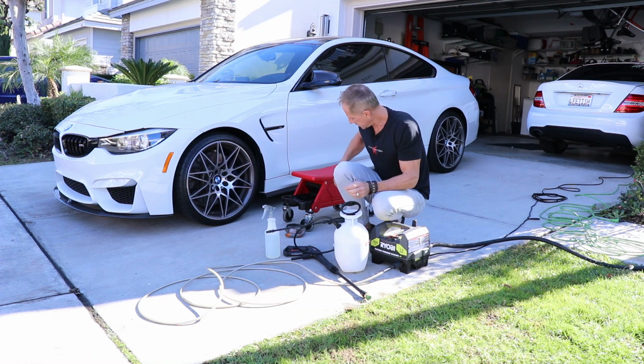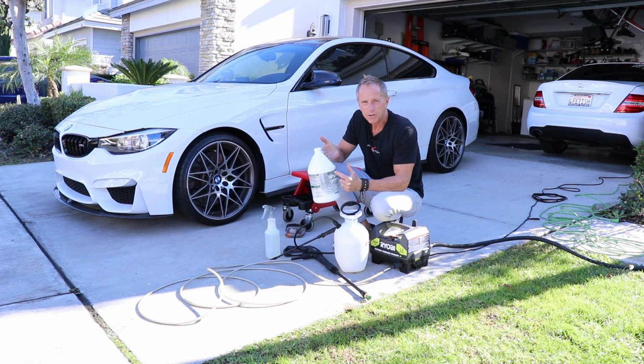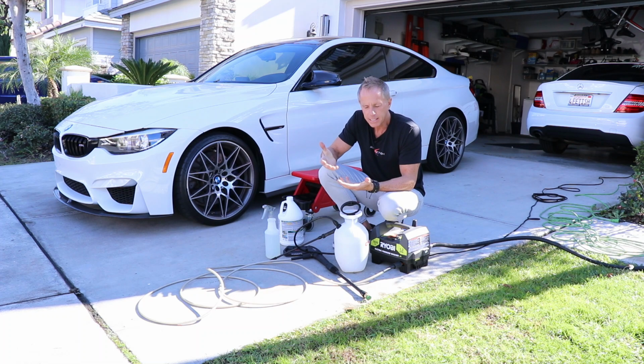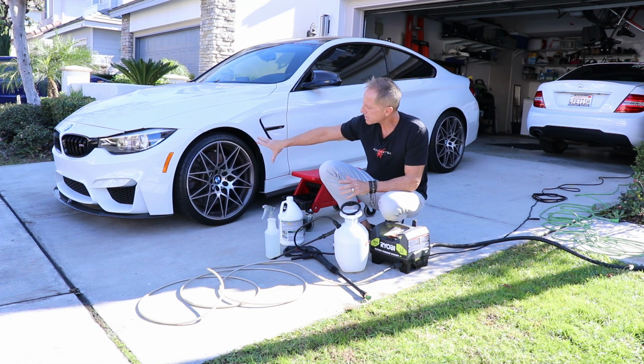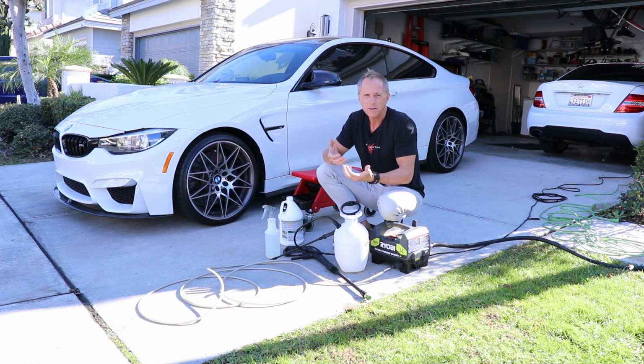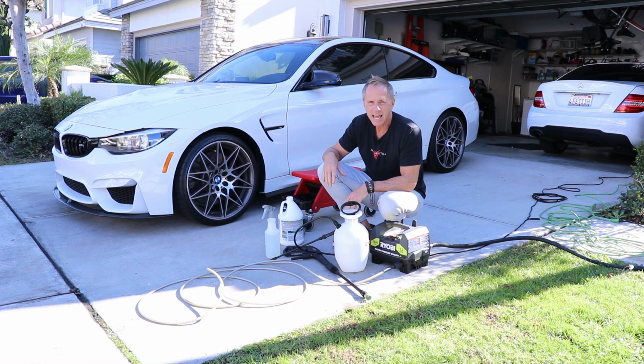Now, what I do default to is Simple Green. It's an all-purpose cleaner. I can use it for many, many reasons. It's very, very economical, way more economical than any dedicated car wheel cleaner. I consider wheels heavy-duty cleaning. It recommends a 15:1 dilution ratio. I'm going to simultaneously clean my wheels as well as the sidewall of my tire. When I clean my tire, I want to degrease it because it will naturally build up some greasy grime along the way. With all that said, let's get into action.